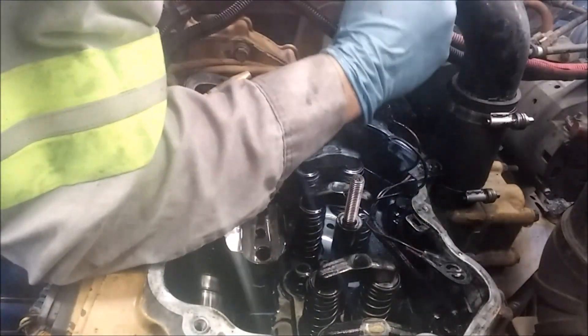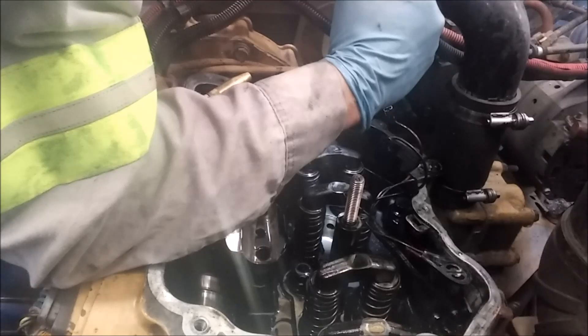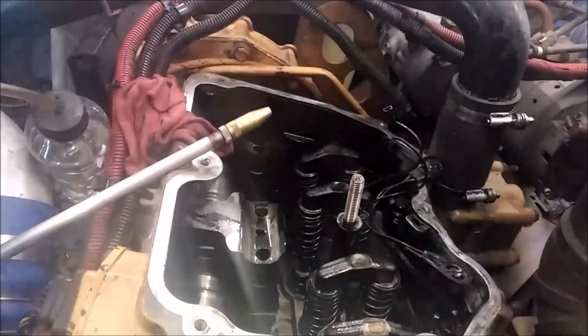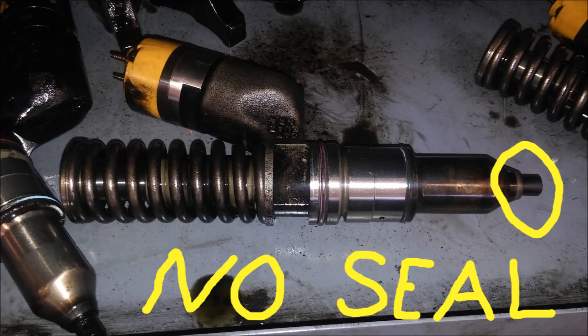We have cleaned the cylinder and the injector bore. You want to inspect it, make sure there's no carbon, no debris, and it looks good. Here's your new injector as it comes out of the box — you have three O-rings: the red and the two blues. You want to inspect those O-rings and make sure they're not damaged. Where it says 'file,' write down that four-digit code. There might be a 12-digit code and a four-digit code if it's a newer injector — if there is, write both of those numbers down. On the old injector you removed, you'll notice there's no seal on the bottom — that's because the lower small blue seal actually burns up and turns to carbon as a carbon dam after it's been run for a while. That's normal.